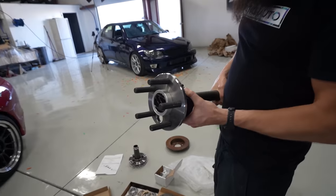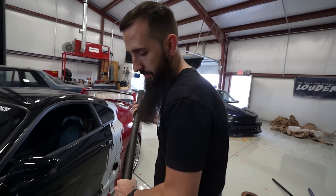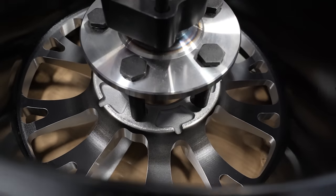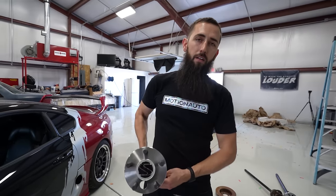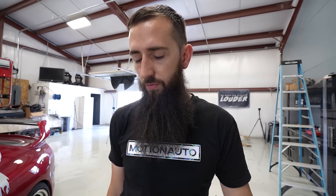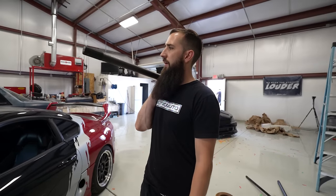Dog. That's a pretty big dog. We were trying to see how it would fit with the lug nuts, because that's a 5/8 stud. So we tried to see if it would fit through there, and it's actually the wrong bolt pattern. Axles are 5 by 4 3/4, and the car, the Mustang stuff, is 5 by 4 1/2. So 5 by 114 technically, but this is technically the wrong thing. So this is what, like Camaro bolt pattern, right? Like 5 by 120.